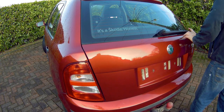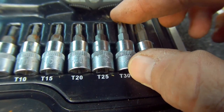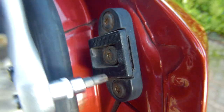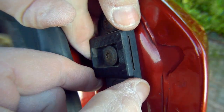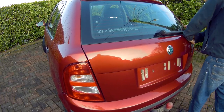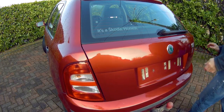So the next stage is to adjust the brackets. We need to loosen the central torque bolt using a Torx T30 socket. Now we can adjust the bracket forwards a bit and check if it's eliminated our knocking noise. It's a little better, but not quite there. Pulled fully out, there was still a little bit of a knocking noise.